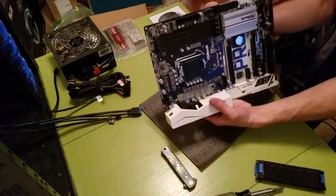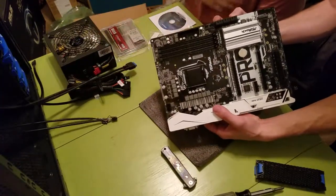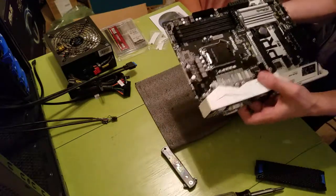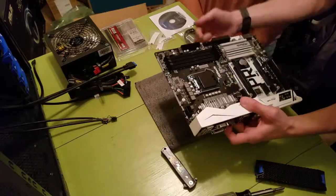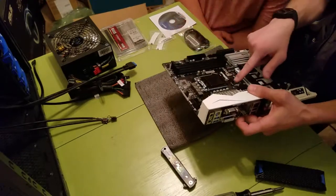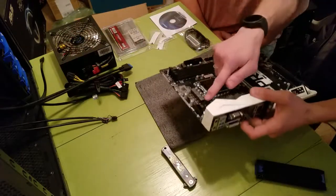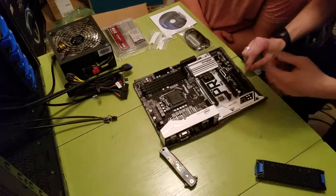And then you've got six drive compatibility there for SATA. USB? No, that's SATA. So SATA's 0 through 5. I know there's 6 drives there, but it starts at 0. Right. You get your M2, your other M2, USB 3, your power to the board, fan. Okay, so you will use both connections off this thing. You'll use both of them on that. This is the power of the CPU. And then, your CMOS.